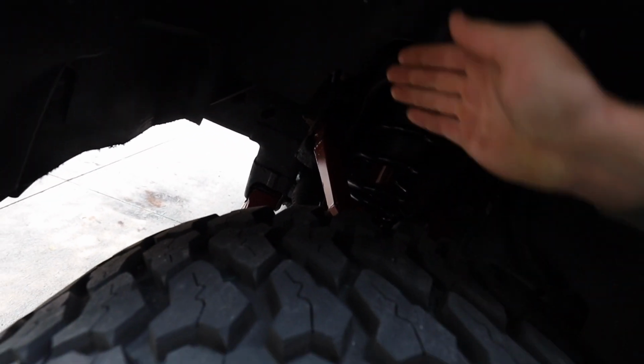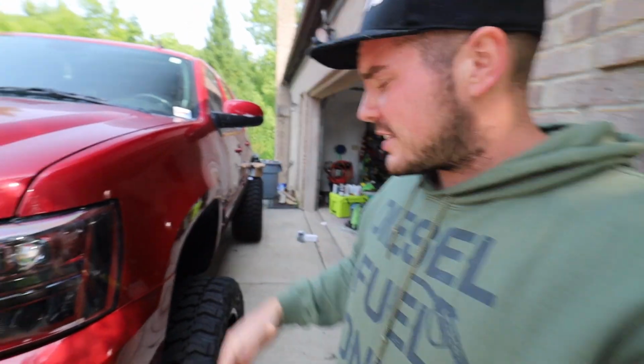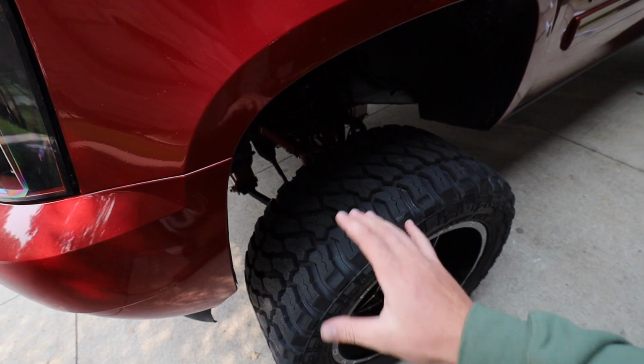What we're gonna do is get up in here, jack this thing up, get our rack out, pull the fluid out of our power steering, and then we will get those bushings replaced today, which will be super awesome. Press them out with our ball joint press, and hopefully that solves all the clunking in the front end, and hopefully keeps that rack tight too, so we're not swaying all over the road. While we're doing that, we'll do the inner tie rods as well.